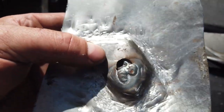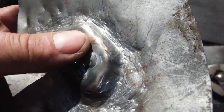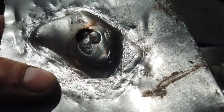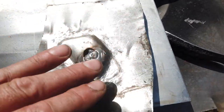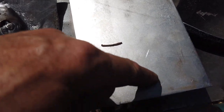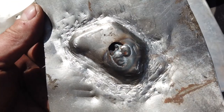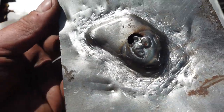What I've done: I've welded a bit of metal to it, drilled a hole in the donor plate, and then welded it to what's left of the jacking point. Then using my little panel-beating hammer, panel-beat round and press the shape into this metal. Then we're going to break the weld off or grind it off, flatten this piece out, and this piece will then fit to the larger-gauge metal - because the jacking point is thicker gauge. We've got the right gauge here. We'll over-skin that onto that once we've really straightened the bash marks out, and you should be left with a clean imprint.